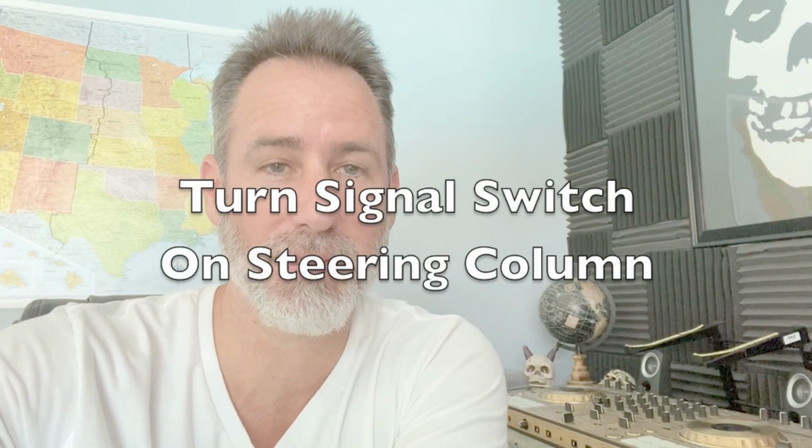All right, the next thing that I'm going to be checking is the output from the stop lamp switch. According to the service manual, circuit A6 from fuse 3 in the power distribution center supplies voltage to the fuse block's bus bar. The bus bar powers circuit F32 through fuse 3 in the fuse block, and circuit F32 connects to the stop lamp switch. When the operator depresses the brake pedal, the stop lamp switch closes and connects circuit F32 to circuit L50. Circuit L50 connects to the auxiliary brake light lamps and the turn signal hazard flashers.